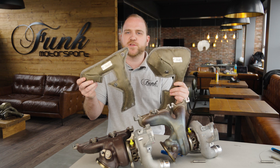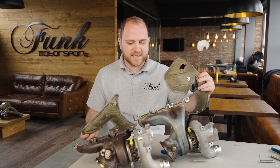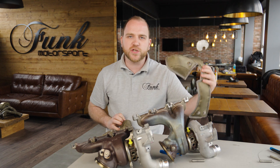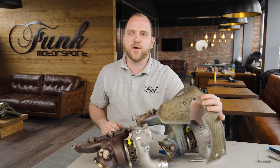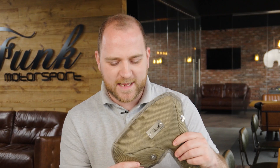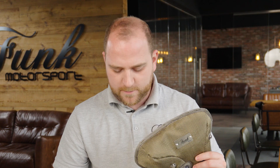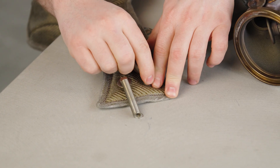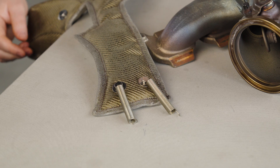In the packet there are two different styles of turbo blankets: one specifically tailored for the front turbo and one for the rear turbo. For now I'm just going to show you the front and then we'll move on to the rear after. Once you've found the correct blanket for the front turbo, first you have to fit the fastening springs on the hardest to reach anchor points first, as always — that's these two here.